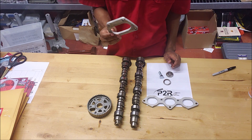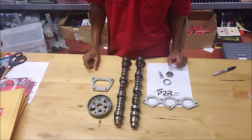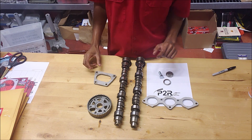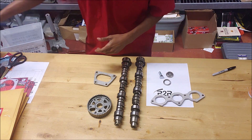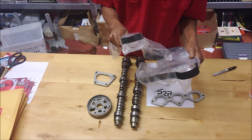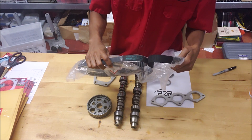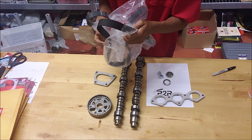A lot of people call them the pre-cats. The next major difference between the two engines is the timing belt size. The newer engines — every J series that has this cast manifold — has a thin timing belt. Any J series that has the separate flange has a thicker timing belt. I have two brand new Honda timing belts here: this is from the second generation engine, this is from the first generation. You can see this one is narrow versus the other which is a thicker belt — a few millimeters thinner.